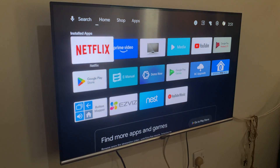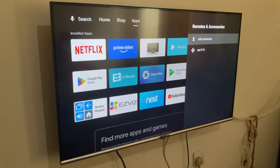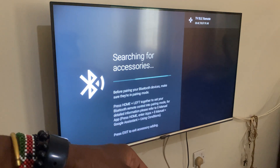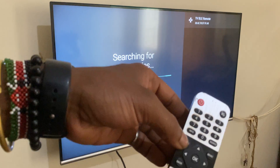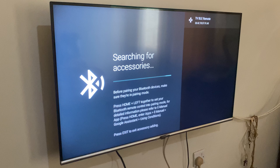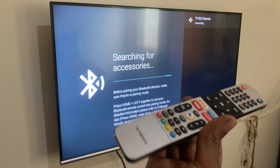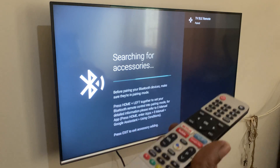So I've been holding the buttons. We go back to the remote menu. I've clicked the remote to activate it. Then it shows the other side — TV BLE remote. Then you're going to go to the other side and click OK. This is going to start pairing your TV to the remote itself, and it has now done pairing.